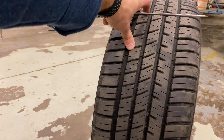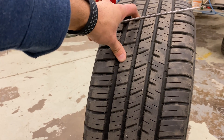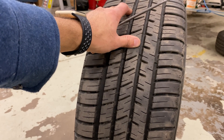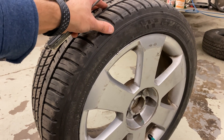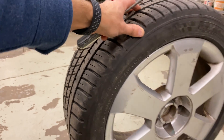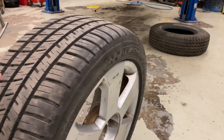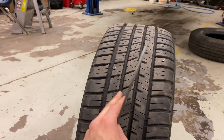As for advantages and disadvantages of the asymmetrical tire, it's really just meant for different purposes. You might have one side that's more for performance and the other side that's more for all-season usability. Usually when I see an asymmetrical tire I find it to be more of a high-performance type of tire — for example, this is a Michelin Pilot Sport AS3 Plus, which is a great tire. Symmetrical tires are usually found to be a little more on the cheaper, more generic side. With asymmetrical, you split it down the middle and it's different on both sides; however it doesn't matter which corner of the car you put it on, as long as you've got the outside and inside oriented correctly.